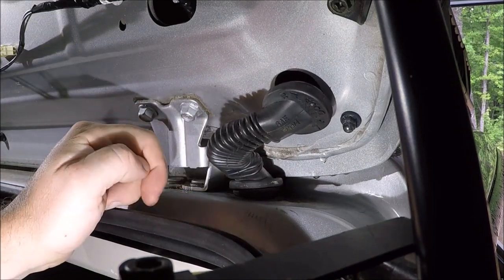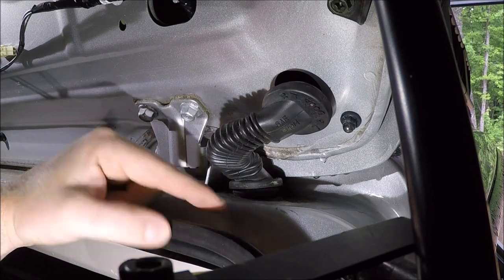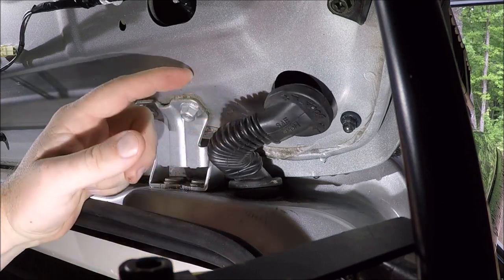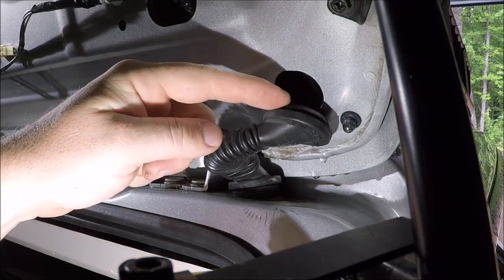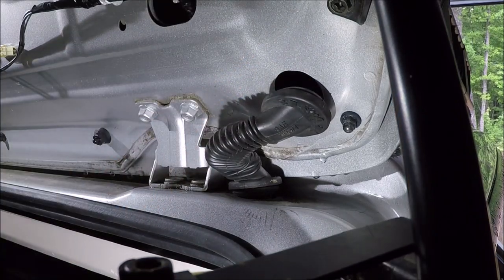We're gonna cut the corrosion and even up our wire. Attach our butt connector, push that connection down inside the car, run the new wire through our wire loom or grommet here. It's gonna be a little harder on this one as there's more wires. Once we get it through, we'll make our other connection and then push that up into the tailgate itself.